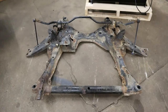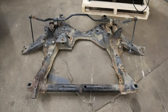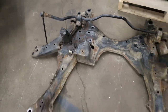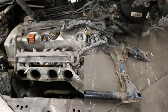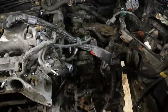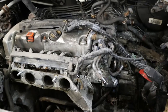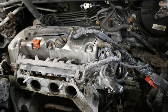What you're looking at to remove the engine from the CR-V — this goes underneath the engine and transmission — this is the subframe assembly. This connects to both control arms and ball joints on either side, and there's your stabilizer bar and everything. Underneath, you also have to drop the exhaust system and the drive shaft, along with the subframe I just showed you.